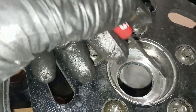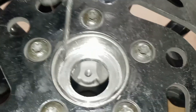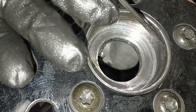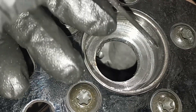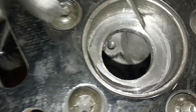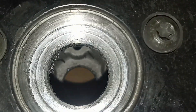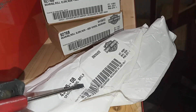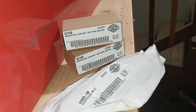So once you get your bearings out, go ahead and inspect the bores of the wheel. Make sure there's no pitting — sometimes the bearing will go in tight at the lip and then just falls right in because the bearing wore out the hub in the wheel. Make sure there's no debris floating around in there, no ball bearings, because you will hear it banging around in this hollow aluminum wheel. We got some new wheel bearings and even a new center spacer. We're going to go ahead and get those installed in the wheel now.